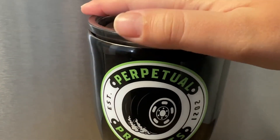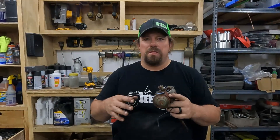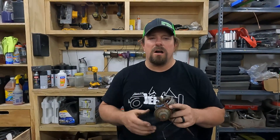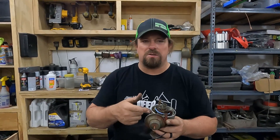Today on Perpetual Projects, we continue to try to get our '66 Fury running properly. We're going to go over 10 things that you should check on your ignition system if you have a classic car with points ignition. In no particular order other than filming convenience — we're sitting at the bench with the distributor out — we're going to start with something I don't hear people talk about very often: checking that our vacuum advance unit is working.